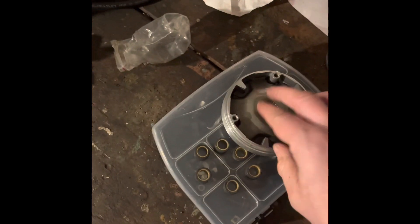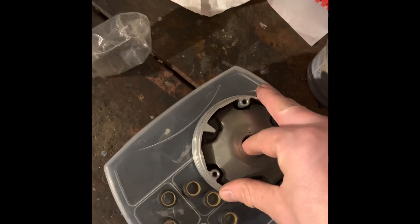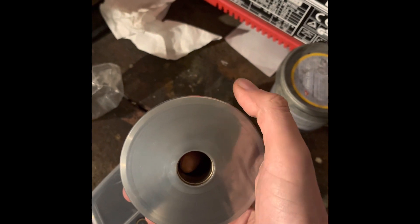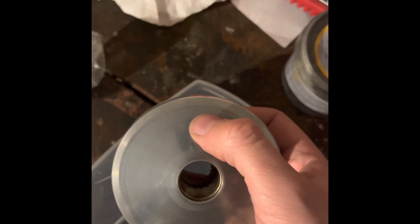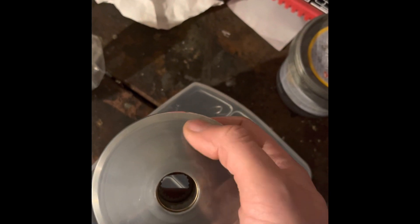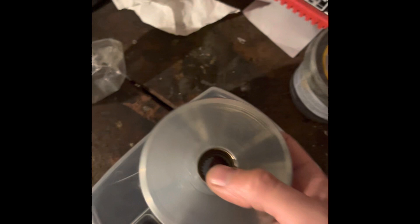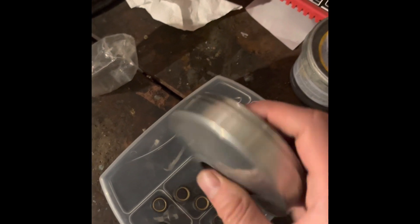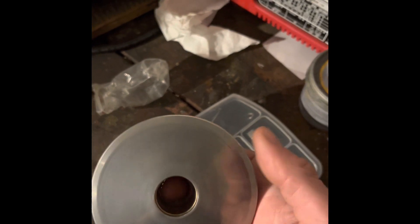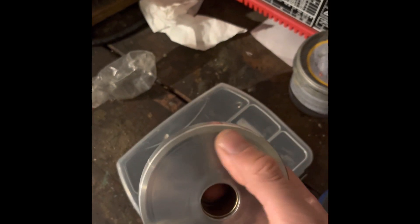What are the benefits? Potentially, if you have a larger diameter roller, it might allow this plate to be pushed out a little bit further than the standard ones, which would mean the belt could potentially travel a bit further up the variator face. You'll notice on my variator here you've got the shiny area and the dull area at the top — the shiny area is where the belt's been rubbing, and the dull area is where the belt hasn't got to. So having those larger diameter rollers could potentially chuck the belt further up, but not necessarily — if the belt isn't long enough, or if it's already riding its lowest point on the clutch end anyway, you're not going to see any benefit. All you're going to do is hurt your performance on the acceleration.